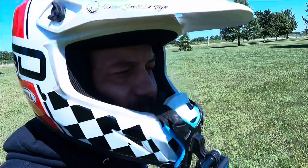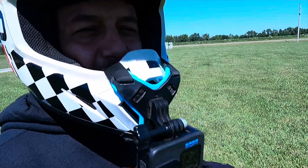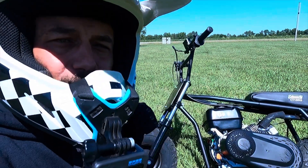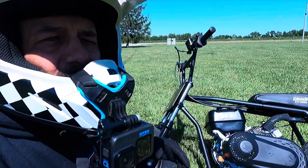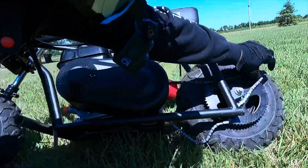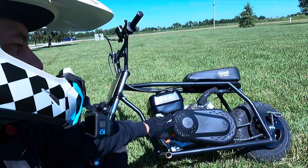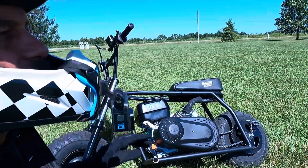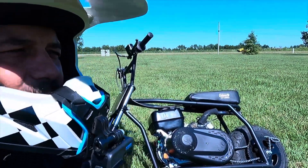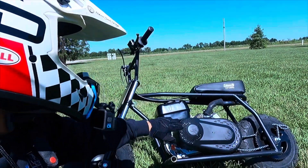The walk of shame. The chain fell off and that is my fault because I ran it hard yesterday and the chain was pretty loose — I noticed that but I didn't tighten it. After you ride a brand new chain, the first ride you kind of got to check it and make sure it's not too loose. It doesn't look like it hurt anything. What a blast this thing is! I like the torque converter — it's definitely good for slower speed stuff, but I think the other way with just a clutch has more top end and is a little bit more racy.